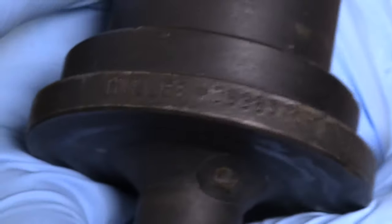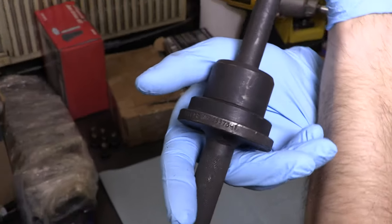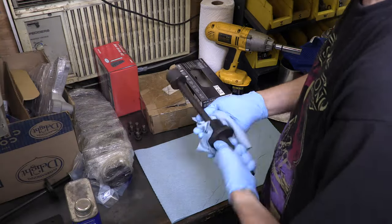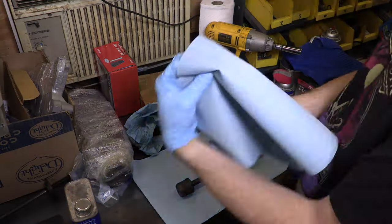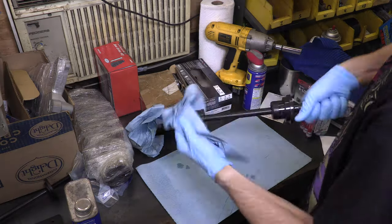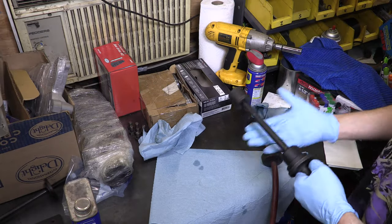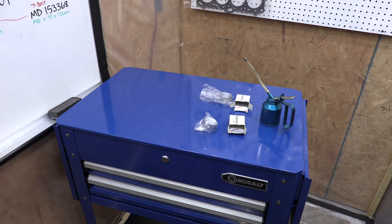This time I've got the actual Mitsubishi balance shaft bearing driver specialty tool that's listed in the service manual. I bought my OEM tools used and dirty. I don't know how else you're going to find them these days. They've been out of production for many years. If you have old factory assembly tools, be sure to keep them oiled. They're just bare tool steel with a light patina on them, so they will rust. There are lots of creative threads on DSM tuners showing home-built solutions for this tool, and they're both creative and effective. I know that I'm extremely fortunate to have these tools, and I don't take them for granted.